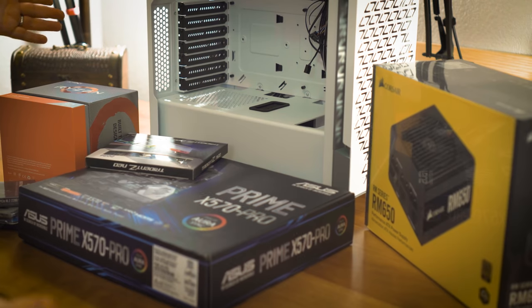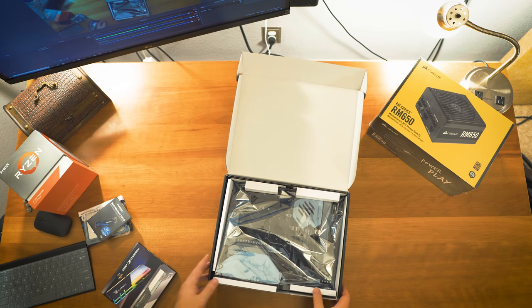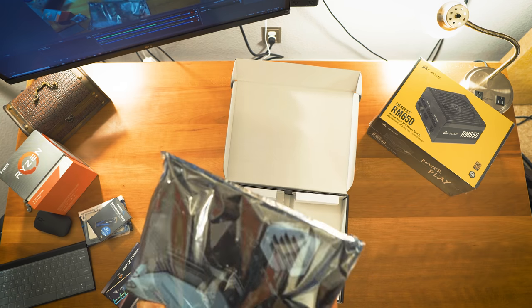I'm going to start with the power supply, because once I plug it in I have a direct ground I can touch to discharge any static electricity. I know some people get very finicky about anti-static measures. I've built a lot of PCs and never fried any electronics, but I'm very aware of touching grounded objects to discharge static buildup. The easiest way is to plug in the power supply, turn it off, and you have a direct connection to ground.